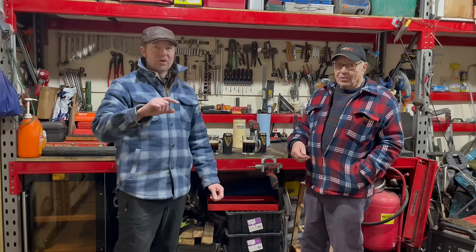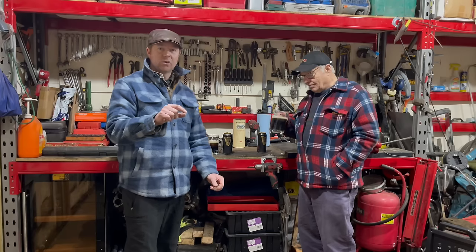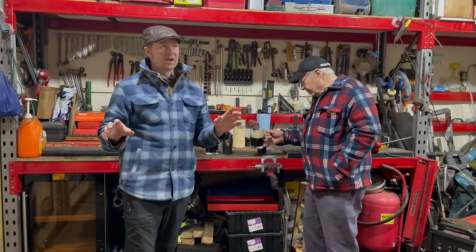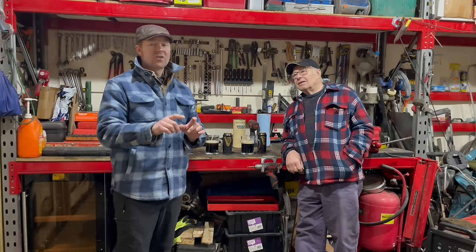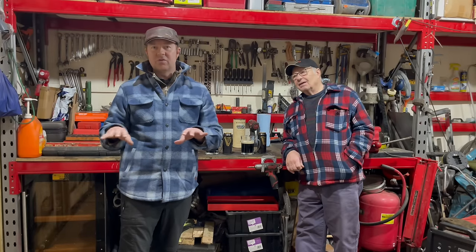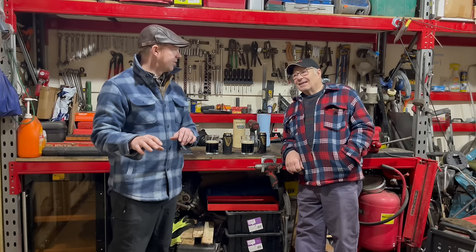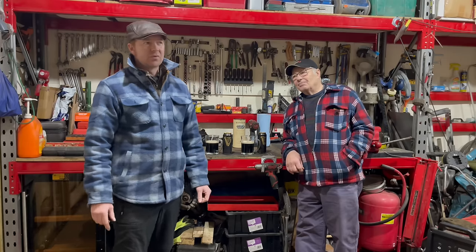One of the reasons why it didn't start, or why it wouldn't run, was because the firing order was actually set up from the front back. It was set up completely wrong. We didn't actually show you that in that episode. I think in the next episode we'll probably show you this. It's really interesting because the Haynes manual was left open in the workshop where the car was sat for the past 24 years, and the pages were yellow. So obviously someone had problems with setting up the firing order. But we got that right anyway.